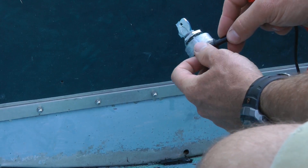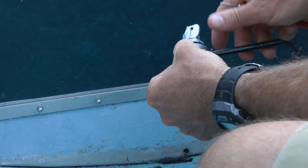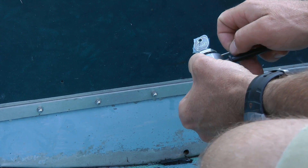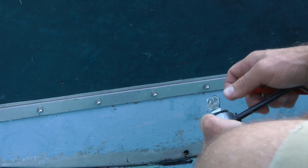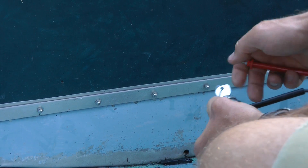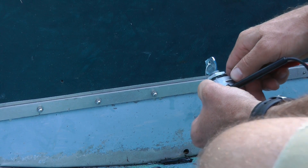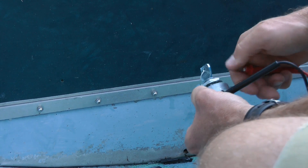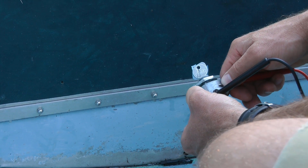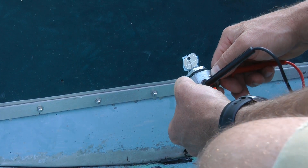What I found was that if you touch the red wire to the metal body — which you know is going to be grounded — it shows that this big red line is... interesting. So when the key is off, it is connected to ground. When the key is turned on, it's not connected to ground. So what that seems to be telling me is that that is the sort of kill switch for the motor — it's sending ground to the coil to short it out and turn the motor off.